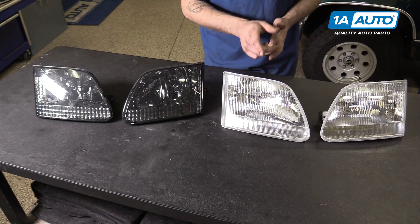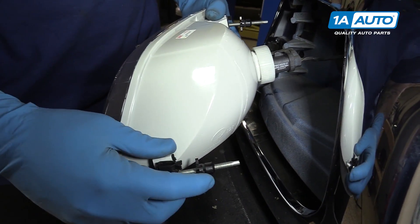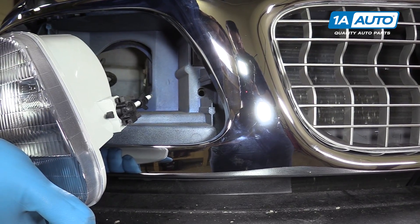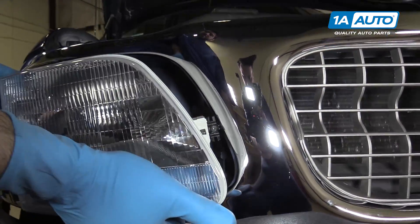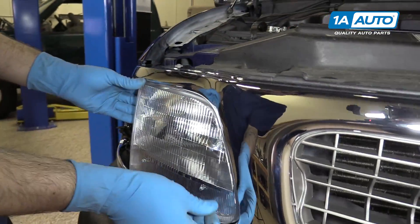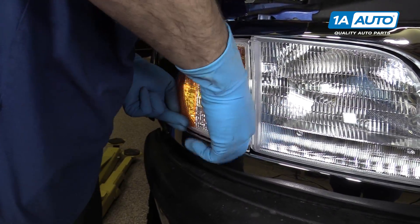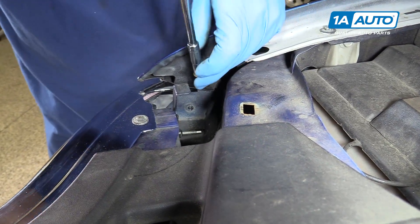Get your headlights nice and bright so you can see safe and fix you up right. Plug in your headlight bulb and line up the pins with their slots so the tabs here will sit in between these two slots and go through that hole. You can see the lock plate and how that works there. You will have to hold this up if your spring is weak and it doesn't keep itself up there. You want to line up the rear ones at the same time. Now you've got your new headlight in place. For your marker light, we'll just plug that in, line it up, and slide it into place. When it's all the way set in, your hole will be lined up at the top. We'll reinstall that seven millimeter screw.